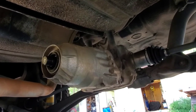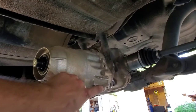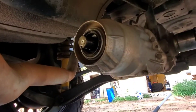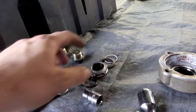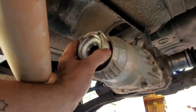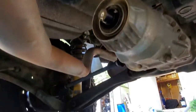We're under the CRV and we're gonna get the cover off the diff right here. These are all gonna be little 8 millimeters — go ahead and loosen all those off and drain the fluid. These are gonna be two 17 millimeters. The nut right here is gonna be a 34 millimeter, just go ahead and break that off — it's not gonna be on there too tight, so it shouldn't be an issue. Once you get the nut off, there's gonna be this little washer behind it and this little plastic one — go ahead and save those. Then once you get the cover off, this is gonna come down and behind it is gonna be this little plastic washer.